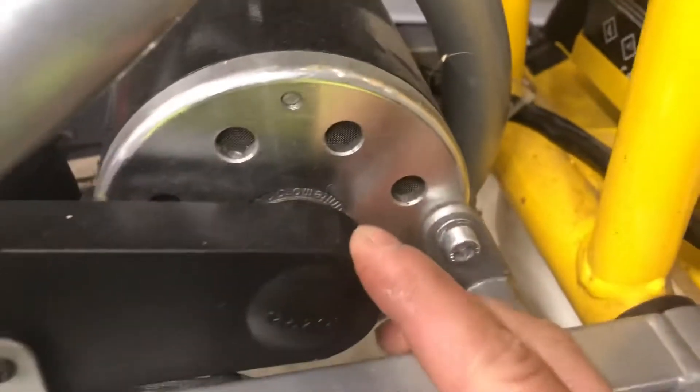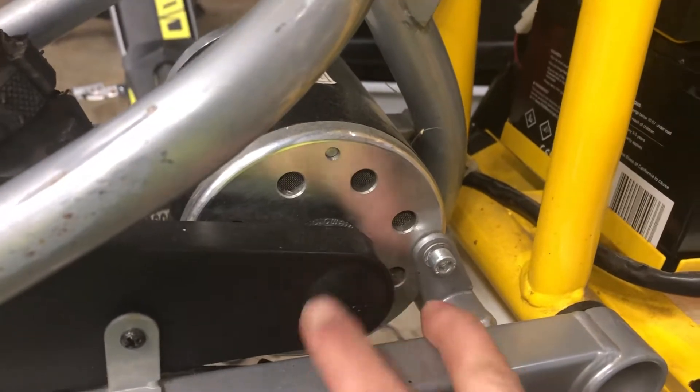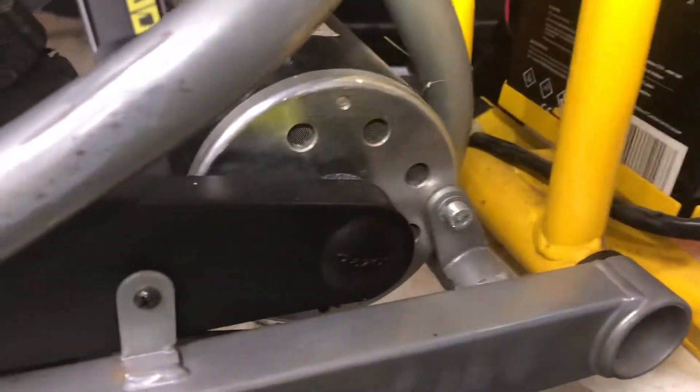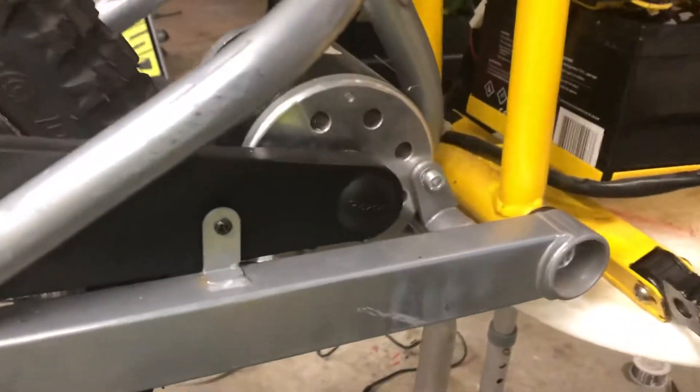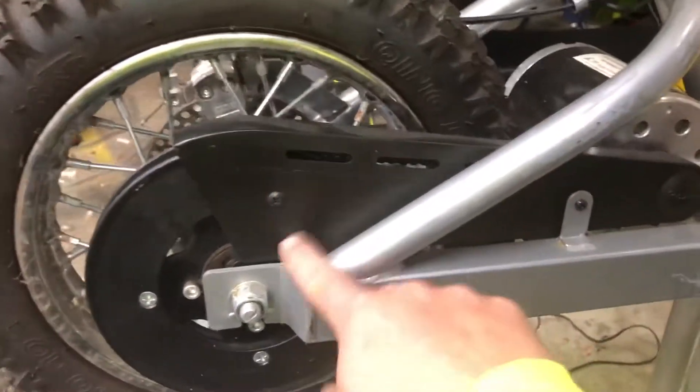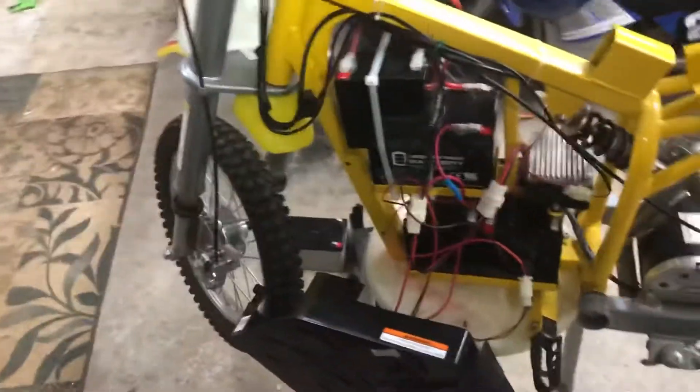What I did was change this small sprocket here — it's only like eight bucks. The stock is 11 tooth; if you go to an electric scooter parts website you can get a 9-tooth for like eight or nine bucks, and it'll drop it down to about 20 miles an hour but with a lot more torque — more low-end power, doesn't take as long to get up to speed. You lose about six miles an hour top end but you gain the torque. To change it you just pop these two screws out and there's a bolt — it's reverse thread. Check out my other video on that. I'm gonna put it back together and it'll look just like a stock bike.